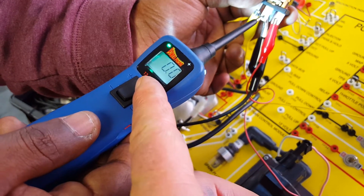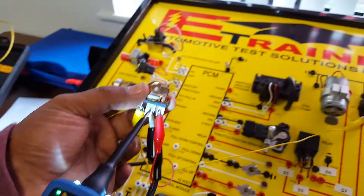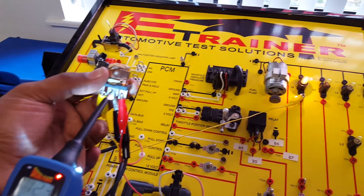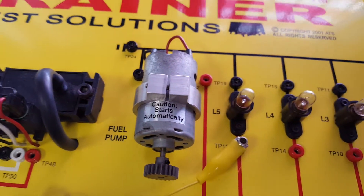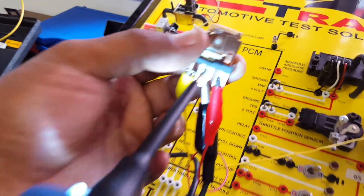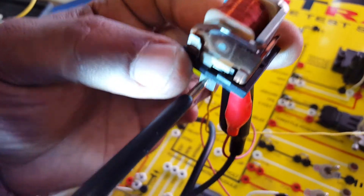When Kevin presses the button you're going to hear a click, and when you hear that click, watch the light bulb. You can see the light bulb is illuminated. On and off — you can see the power probe switching on and off. Let it click — you can see the relay being pulled in. You can actually see it right here.